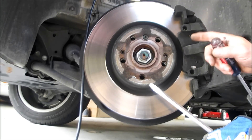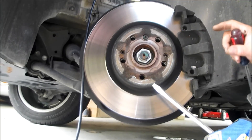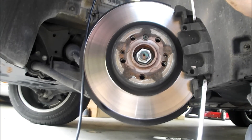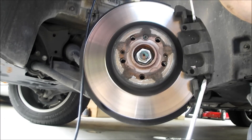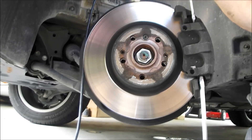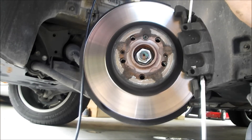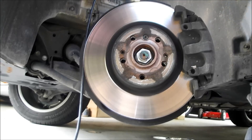Before you do this, open the hood and release the top of the brake master cylinder in case the fluid has been filled up. When you pry back, it's going to force fluid back up into the reservoir, and if someone's filled it up, it's going to pop the lid off — and you don't want that. So just to be safe, take the lid off the master cylinder. In a lot of cases you won't have to do it at all, but you don't want to take the chance, so go ahead and do it.